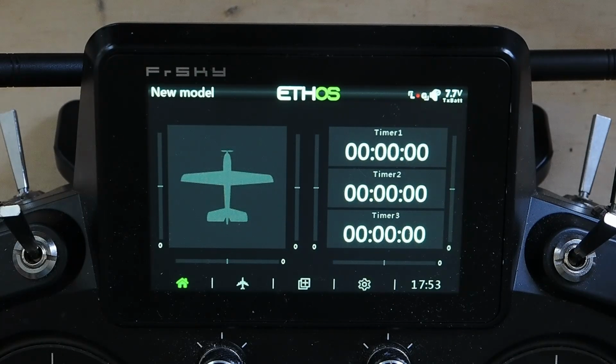on. With glow and gas, it's a little bit more complex than that because you have a throttle cut which cuts the engine, turns that engine off, and you have an idle position which is your normal on the ground, engine just barely ticking over. Now you may combine that idle position with an idle up as in Tech Tips episode 3. However, from a ground perspective, you need to be sure you can kill that engine on the ground with the flick of a switch, as well as have a steady and adjustable idle.